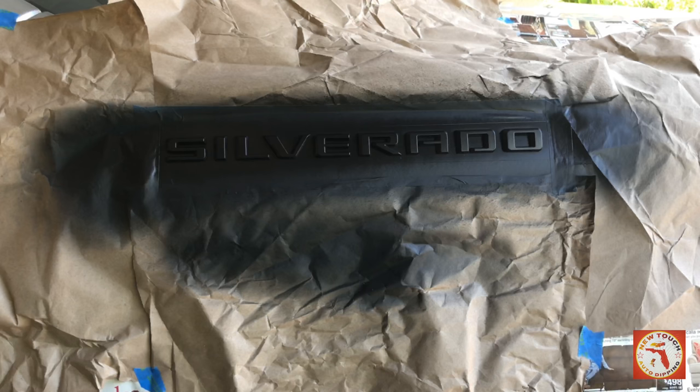Down to my last coat of HyperDip. Now normally with Plasti Dip, I would have gone over this 6 times because that's pretty much the average. With Plasti Dip spray, 6 coats. But with HyperDip, it tends to behave differently. So you would double the coats that you would normally do with Plasti Dip. So this will be my 12th coat.